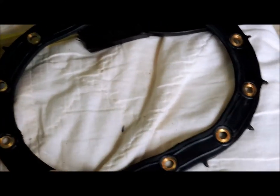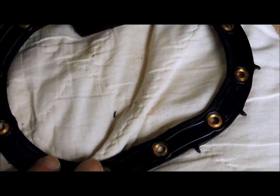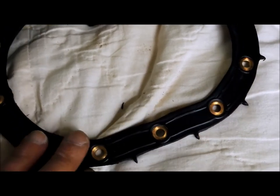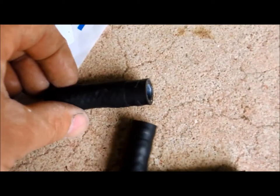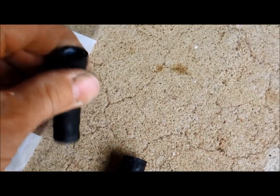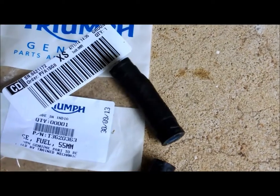I learned that there could be strange things in your gas tank that don't belong there — I don't know how that ever got there, but it's obviously from the previous owner. I learned that the gasket screws for this plate can loosen up, because the ones that came out from the original were definitely looser than what I put back in under the spec they recommend. And I'm glad I replaced the fuel hoses, because I think the ethanol in the gas is hardening them up — these definitely don't feel as good as the new ones.